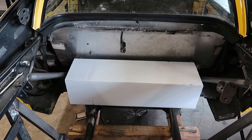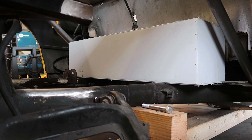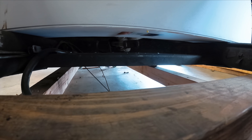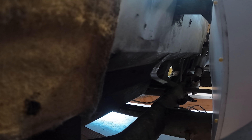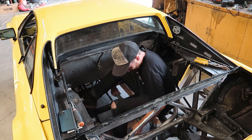The finished mock-up cell sits well in the car. It's got room to spare between the frame rails and it's sitting just off the bulkhead thanks to the former factory fuel tank strap mounts. There's room behind it for those coolant tubes, which is a good sign. Although once I got it in here, I realized there's enough room underneath to pass those tubes under if I'm willing to redo them — and that seems like the right move. I'm losing a lot of space behind the cell that could hold more fuel, and as it turns out later, I'm going to need it. So I'm going to pull that eight-foot aluminum coolant tube out and rebuild it later in the process.